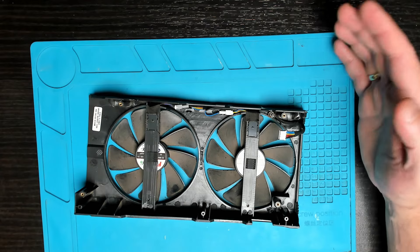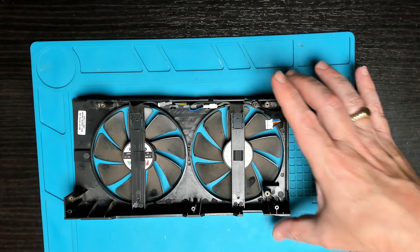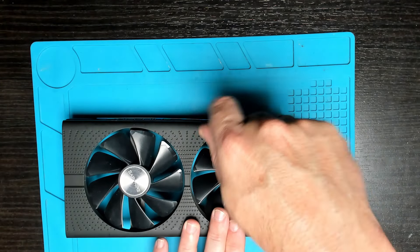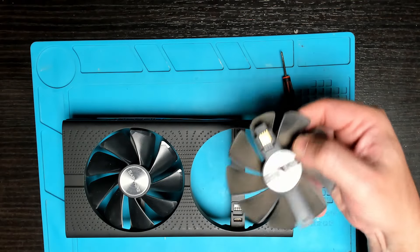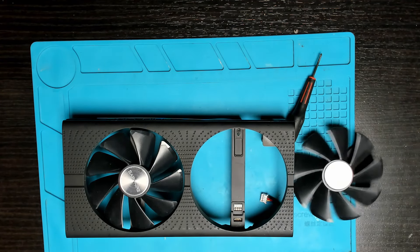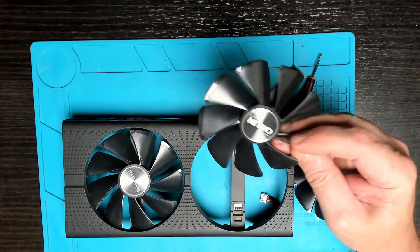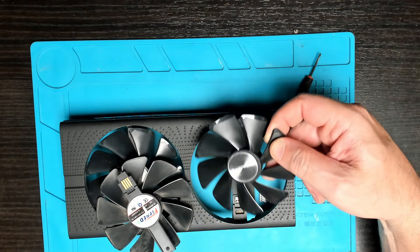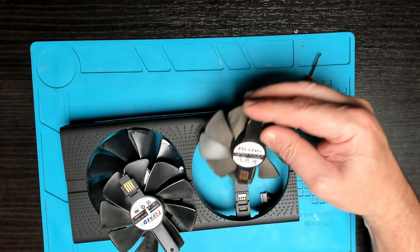So what's the fix? Looking at all these cables and daisy chains it looks complicated, but in actual fact you have one Phillips screw and the fan just pops out. There are four contacts on the bottom of the fan and four spring-loaded contacts on the graphics card. Get rid of the faulty fan and get a new one. This is the Nitro fan I took out of the customer's card that was stuck on 100%. I got a fan from a Pulse edition, which is exactly the same size and specifications, and it worked perfectly — the fan is regulated and I can control the speeds using Sapphire Trixx, no problem.